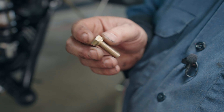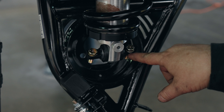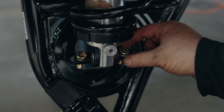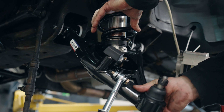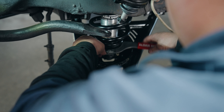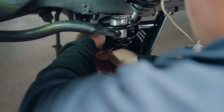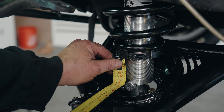I put the bolts in the T-bar to make it easier to line up with the lower holes in the control arm, using smaller washers for a bit more flexibility to float in the hole. With the spindle still off, I adjusted the spring seat to preload the spring — I already know from doing the other side that two inches of thread exposed gets the ride height where we want it. We're not lowering this car; we're putting it back to about stock ride height because my buddy Larry wants it to look more like a stock sleeper.